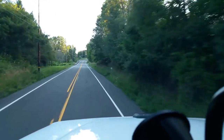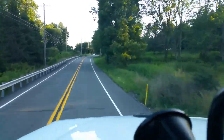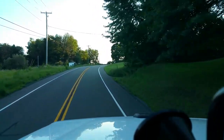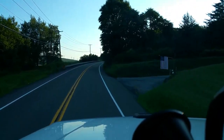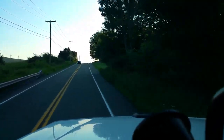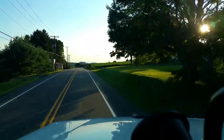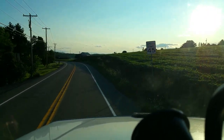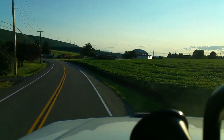I'll show you the transmission selector later when it gets dark. There is a mode function on the transmission. If you have it out of mode — just in automatic on drive — it will give you the highest gear it can for the best fuel economy. If you put the transmission in mode, it's just like taking away the passing gear in a car: it keeps it one gear lower than you normally would. It does not care about fuel mileage — it's going to give you as much power as it can.